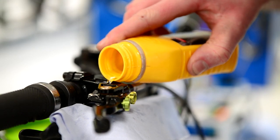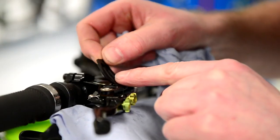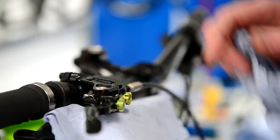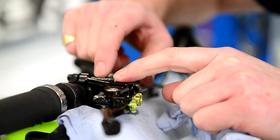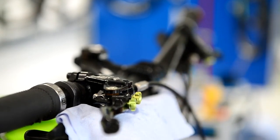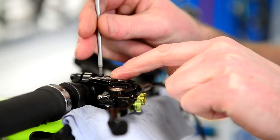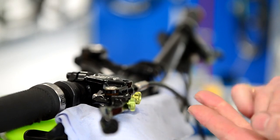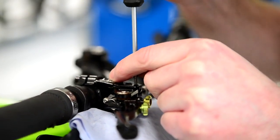Take a little bit of oil to finely top it up, getting as much in there as you can. Then sit the diaphragm in at one end and just roll it in — this fills the rib inside. If you place it directly in, it will pocket the air, which is obviously what we're trying to get rid of. Then just tap your cap on nicely, making sure it's seated properly because sometimes with the diaphragm it can be just off on one side. Give it a gentle tap — if it doesn't look seated, generally it isn't, so just make sure.